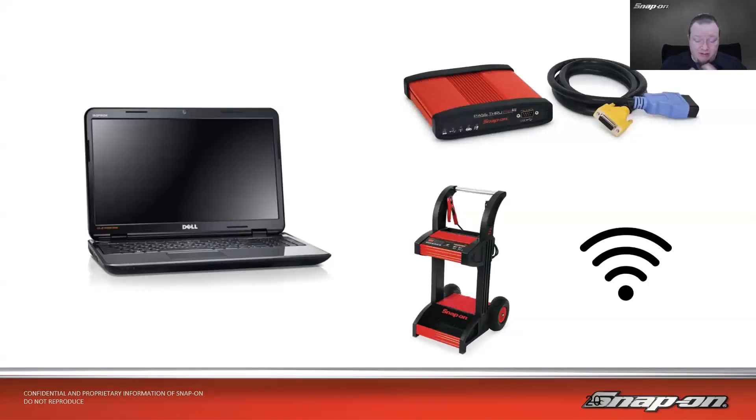When it comes to flashing a vehicle yourself, you can do it — there are plenty of ways. You will need some equipment; you won't be doing it with just your scan tool. Pretty much any manufacturer that allows flashing uses a J2534 box, also called a pass-through device or JBOX — it's all the same thing. Ours is the Pass-Through Pro 4. Pretty much all boxes in the industry are made by the same company and are all roughly the same price.